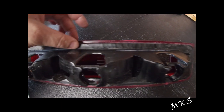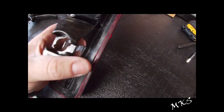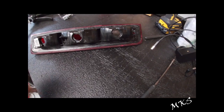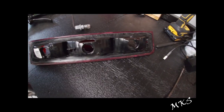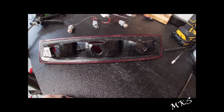As you can see, we've got the third brake light cleaned up. Be careful — we got a little bit close to it with the eraser wheel, and you can see these little ripples from the eraser wheel staying in one spot too long. Just be a little quicker with it. That plastic is really soft, but it'll be fine once we put the sealant on because it's going to fill in those voids. What we're going to do now is just wipe it down with denatured alcohol, then install our light harness back in it, and we'll show you putting the sealant on and how you want it to roughly look. Make sure you wear gloves with this stuff because it is very tough to get off your hands.